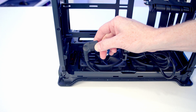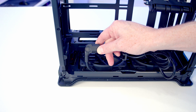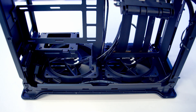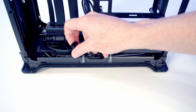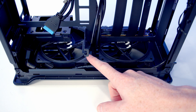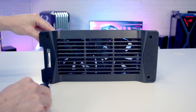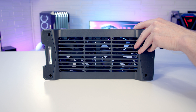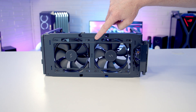At the bottom of the case there's a cable extension for the power supply — it goes into the bottom of the PSU with the other end running to the back of the case. Fractal have installed two 120mm PWM fans at the bottom, with cables managed on the GPU side using Velcro cable straps that can be daisy chained. If you did want to remove the fans, there are four screws in the bottom to remove, then pull the bottom panel forwards to access them.